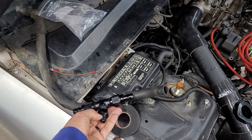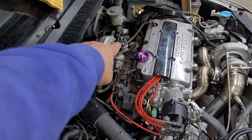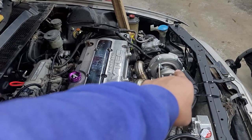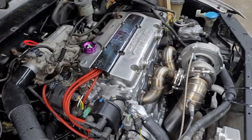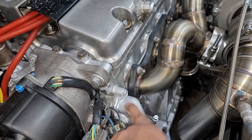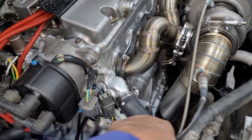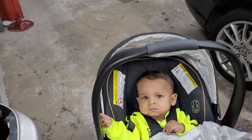The plan is to run it from pretty much right under the manifold, wrap it around, and run it to the turbo from the bottom side — that'll be the inlet. Then the outlet we're going to run into — that's why we bought that drill — we're going to drill and tap either here or maybe on top to make it simple, so the water will flow out of the turbo into this and back into the radiator. I got my helper with me today, what's up Jace!